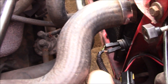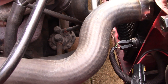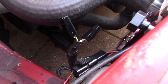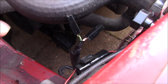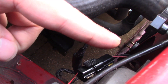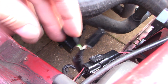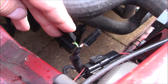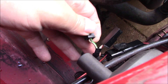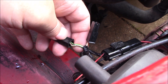I'm not 100% sure what's going on there. It might just be the connectors here are just a bit dodgy. It seems to work when I'm on the move, so I don't mind. I spent a little bit of time having a look around the engine bay. I now know what works and what doesn't. I know the fan switch over here works perfectly fine — that's not an issue. So I know the problem is somewhere in this section. And I noticed there's a bit of a split there.